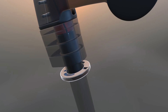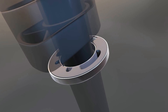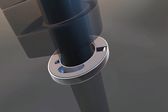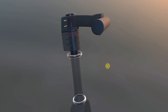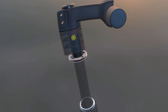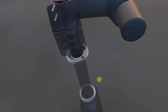Here's another possibility. If everything's working correctly, as you turn the handlebars the bearings will be nice and smooth and everything will turn properly. However, if your bearing gets horribly worn out, gets seized, gets full of mud and grit and generally just doesn't work and gets stuck, then there is a possibility the steering tube will just rotate inside that ring and that could cause wear on the steerer — or not possibly at all, it will do. So there are some possibilities I could see of things going wrong in this area, and that's why it's critical to have your headset adjusted correctly, to have good smooth bearings, and to have your compression plugs in the right place. I've literally just used my common sense there — if you can see any issues or if I've missed anything, leave a comment down below.